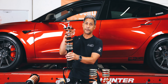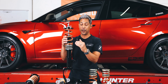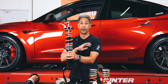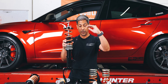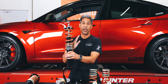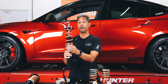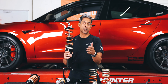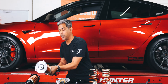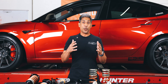Then you go ahead and install the spring. If you're running really high spring rates, you'll need to install the helper spring so you can control the actual droop and height of the vehicle. If you don't have a helper spring, what will happen is — to get to your desired ride height — the main spring is just going to be flopping around with no preload, unable to maintain its position. In a droop situation, the spring might flop out of place, score the piston shaft itself, and not settle back into its right position. So helper springs are there for a lot of various reasons. We've already worked on so many different suspension systems, so I have a pretty good idea of what those compressed lengths should be as well as the free length of the shock — I've preset those up. But if it's a new application you're not familiar with, you'll want to go through that process.